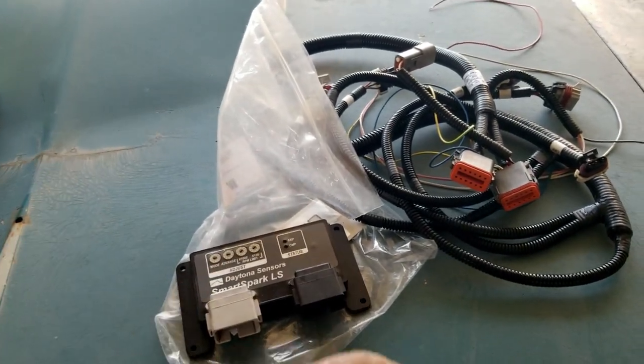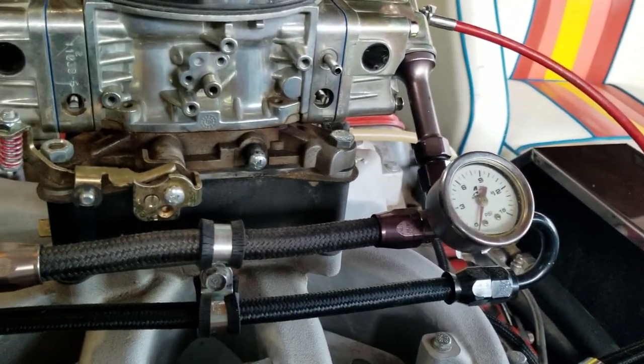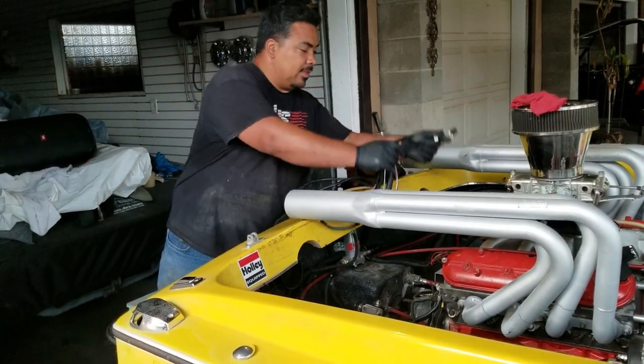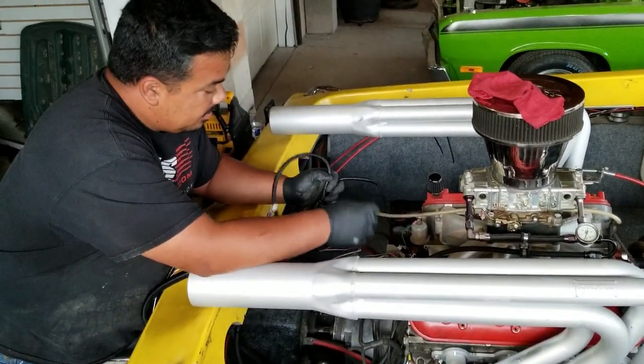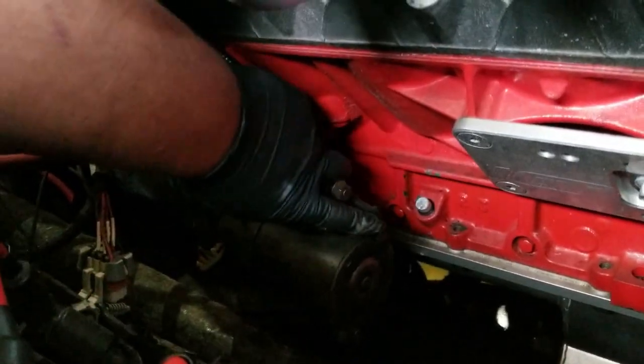For fuel supply, there are a few off-the-shelf fuel pumps you can just pick up — links are in the description. For people converting from a fuel-injected vehicle to a carburetor, you'll need a bypass-style fuel pressure regulator, which gets a bit tricky. For the majority of people retrofitting a classic car that ran a mechanical fuel pump: since the LS has no provision for a mechanical fuel pump, the easiest solution is an inline fuel pump. An in-tank pump works too but is more expensive and more complex to install. For our boat running naturally aspirated at a constant 6 psi, an off-the-shelf fuel pump with a dead-head regulator is all you need. My truck is turbocharged and needs higher fuel pressure, so I ran an in-tank pump.